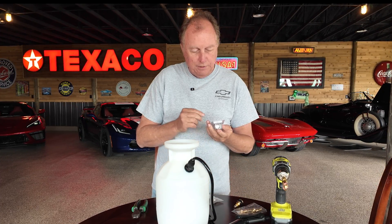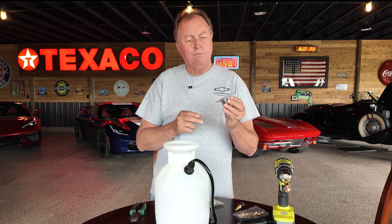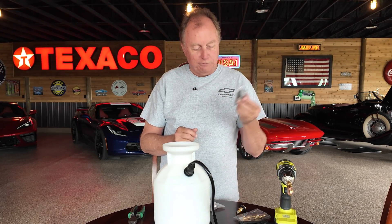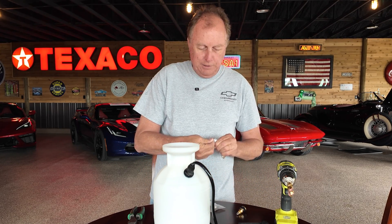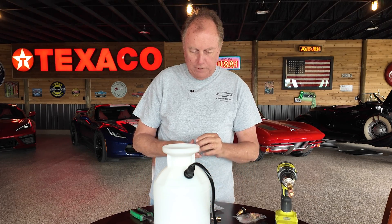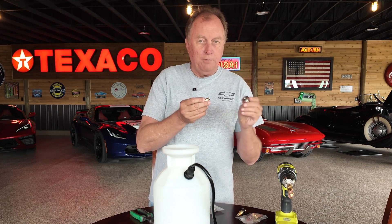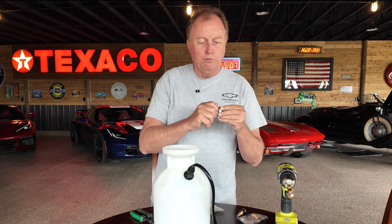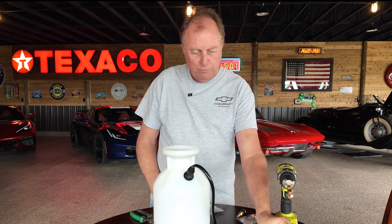The very first thing you're going to need is a 16mm 1.5 to a 1/8 inch NPT fitting. That is going to screw into the plug in your block on your LS engine. And then what that's going to connect to is a 1/4 inch hose barb. So we'll go ahead and open this stuff up. This is an NPT fitting on this 1/4 inch hose barb — we're going to screw that in. I'll eventually put some Teflon tape on this to make it fit a little bit better.